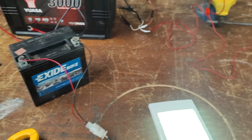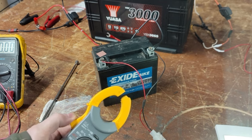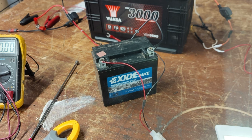Right now my pretend parasitic load, my LED light, is drawing about 250 milliamps — a quarter of an amp. That's extreme for a healthy vehicle chassis battery. My own craft draws about 70 milliamps, 0.07 of an amp, when the vehicle is turned off and all the electronics have gone to sleep. That's a result of the Android head unit with a backup supply, plus two alarms and a tracker all running off the chassis battery. So I've got a known parasitic load in my vehicle.